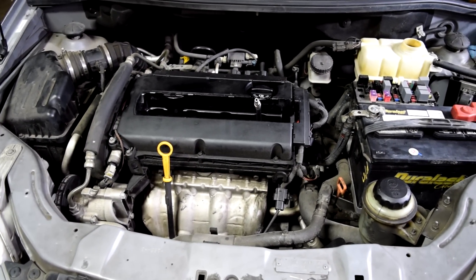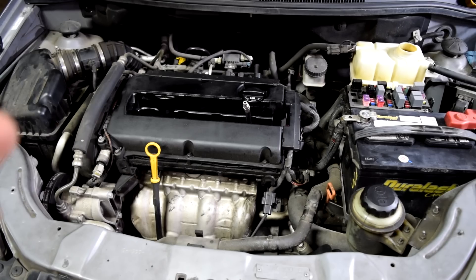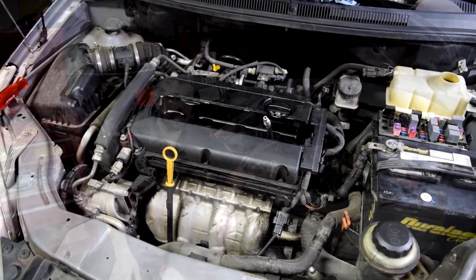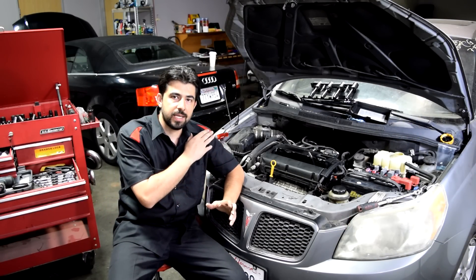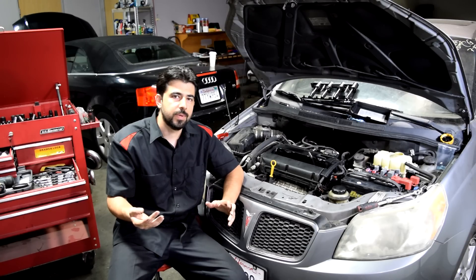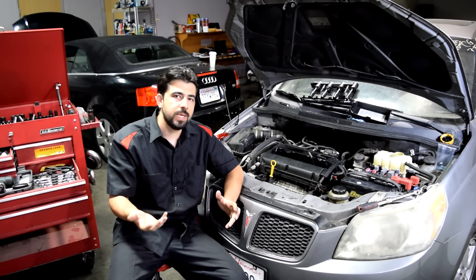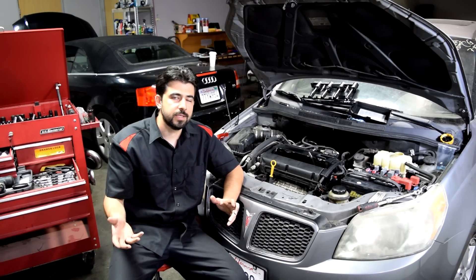As far as what I'm going to do with this engine, I'm actually quite happy with the results today — I don't have to replace this engine. It looks like I'm going to be able to do a head gasket job and get it back on the road. Now, I need to clarify something important: just because we verified combustion gases can get into the cooling system, that doesn't mean the head gasket is definitely the problem. It could be the head gasket, or it could be a crack in the cylinder head or the block. But all things considered, the most likely scenario is a weak or bad head gasket and maybe a warped cylinder head.